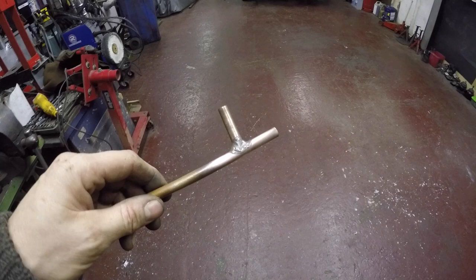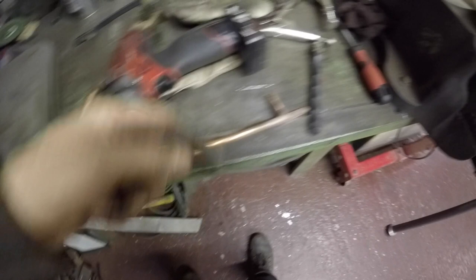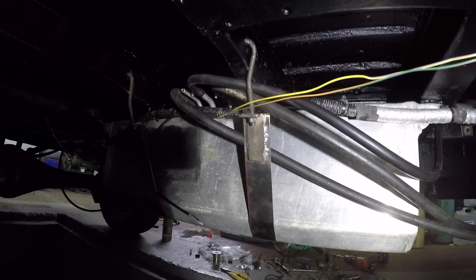Made myself a little tea-piece - I was trying to solder it but I ended up brazing it with the TIG welder, first time I've done any brazing with it. So basically it's just a tee, and then that's just like a 3mm reducer - the return going to the tank restricts it for the pump - and then it goes into the filter. So I've got all that plumbed in now. The feed goes into the pump, then the pump into that tee - that tee's got a reducer in it, that goes back to the tank, and one goes to the filter - and then out of the filter straight to the engine. And then there's the return from the engine. So we've got two returns - one from the tee and one from the engine - so they're all in there, all good.